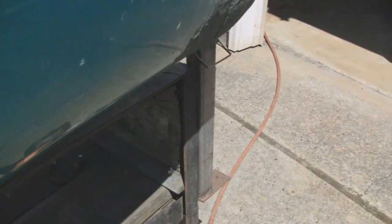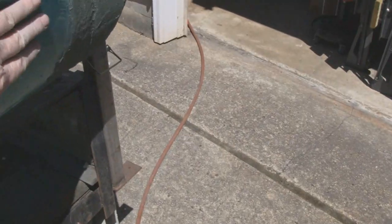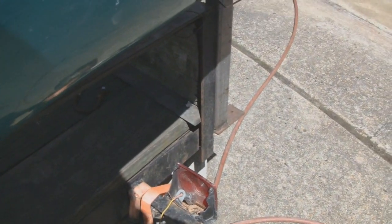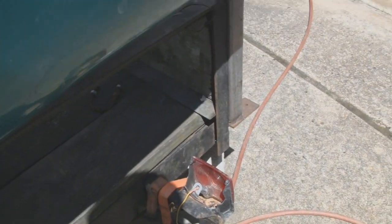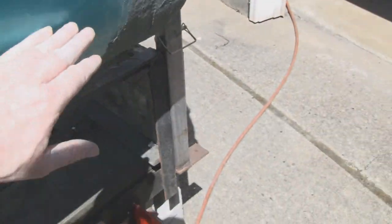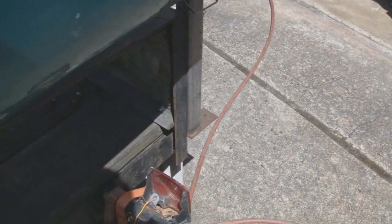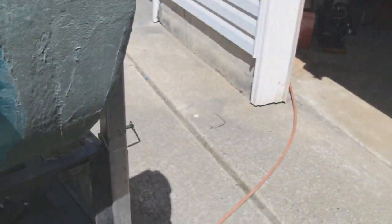Yeah, I just stuck my hand under here and it does feel pretty bad. This thing was kicked in pretty bad at one time right here, and it feels like they might have had holes in there. Well, you know what? I don't know if there was body molding down there or not. But anyway, I could feel globs of putty. So there's going to be holes we're going to have to fill in. So good idea. We'll grind that down to the metal, at least up to here. No sense messing with the fiberglass.